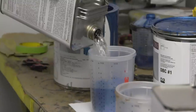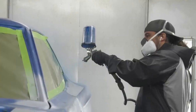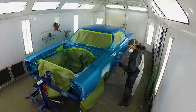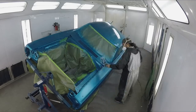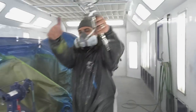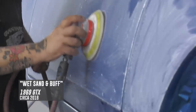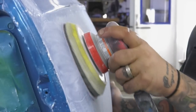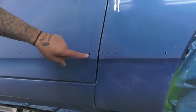B5 is a very transparent color — probably a little more transparent than most. It takes extra coats to cover, so you're looking at about five coats and then two drop coats. The drop coats mean you're painting the car in a different direction — that prevents the metallic from not laying out correctly. Do those drop coats, the metallic lays out even and it looks great. Just like every other car we do, you have to cut and buff it. I've always done my own cut and buffs. It takes about a week to do a complete car — the more you buff, the richer and shinier it looks. You want every swirl out.